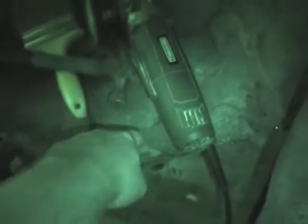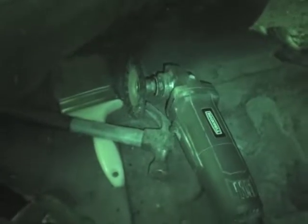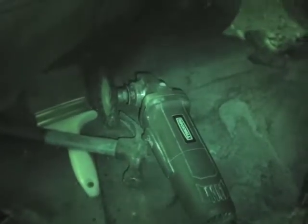I've got eye protection on because I can barely see. As you can see, I've cut out simple geometric shapes and I've just got to weld things back in. I've got to finish off that cut there to make something I can weld to. Then I've got a big hole in the floor pan here. Otherwise the rest of the floor is perfect because none of the undercoating has come up. I'm getting some masking tape to start templating and I'll show you how I template metal and how we weld it in.